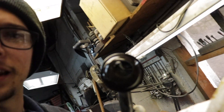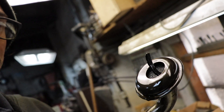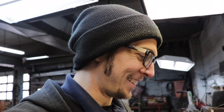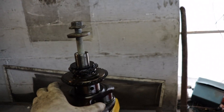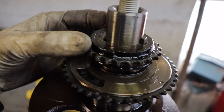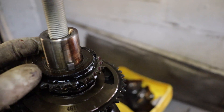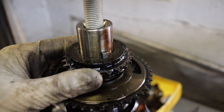I'm a little confused. I just pulled the pickup off the bottom of the oil pan and found this piece wedged in there. I put it back in, but it was definitely in there when I pulled it out. I'm not exactly sure what it's for yet — I'm sure I'll figure that out as I pull more apart, but it doesn't look good. It's a good thing I'm rebuilding this. Found out where that piece came from — you can see the outer ring on the sprocket, and half of it's missing. Would have went right in there. That's my problem.